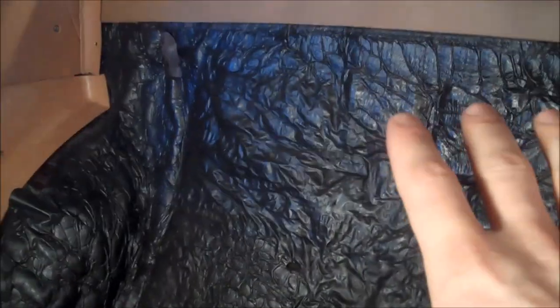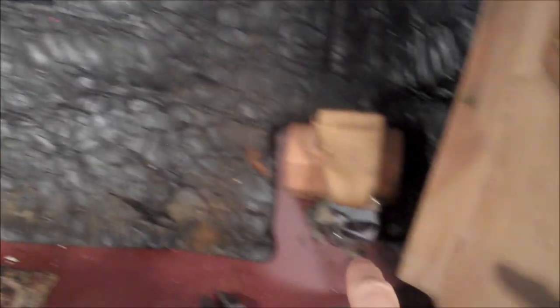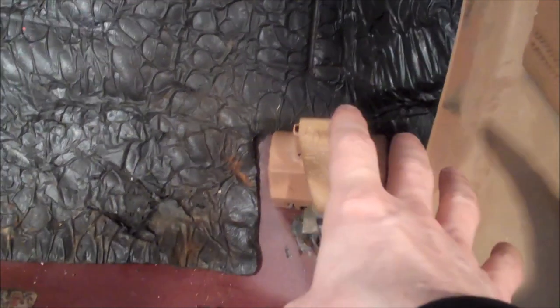In order to get to it and make things a lot easier, you need to remove the lower cushion and the upper cushion. The upper cushion is held on by the two bolts that hold the retractable mechanism on the rear seatbelt itself. Once those are out, the seat lifts up — it is hooked on three hooks on the backside, so simply pull it out. Then you'll need to remove the Phillips screw there, the B-pillar molding, and the aluminum sill plate. Once all that is removed, you can pull the back panel aside and there is the shoulder belt retractable ratcheting system hiding back in the quarter panel.